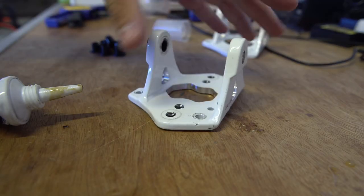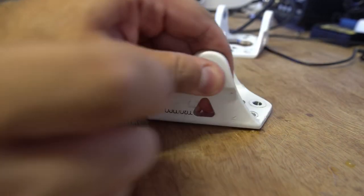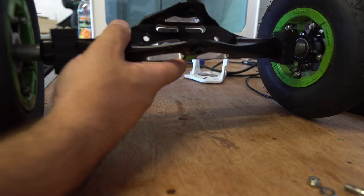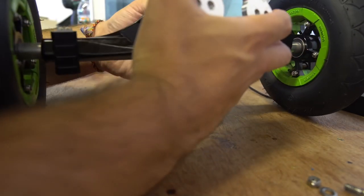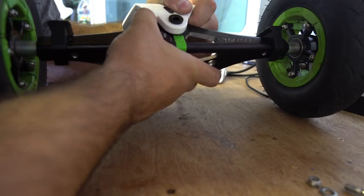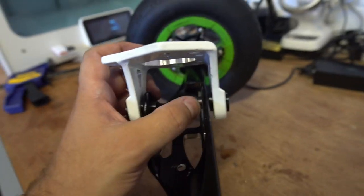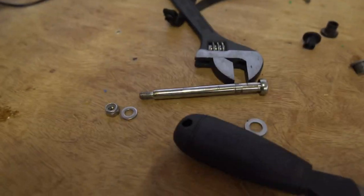It's supposed to be tight — that's the aim of the game. There we go, that's done. Same with the hanger. Now we've got fresh bushings installed in both of these, and if we got these measurements right, this hanger should be a little bit tricky to get on. But there should be a tight fit between the base plate and the bushing on the hanger, both sides. And it is — it's a nice tight fit, so that's all good. Time to install the kingpin.